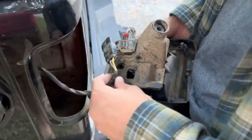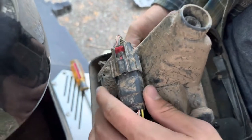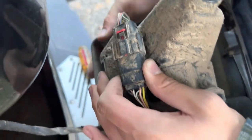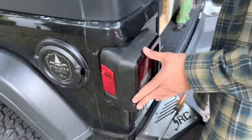We're going to put the tail light back in — it's just the reverse of what we did. Put the retaining clip in and then that just plugs right back in until you hear a click, then push the red tab in and that locks it in place. Reseat the light and then put the bolt in the back and we'll be done.